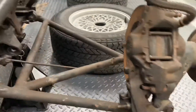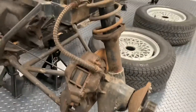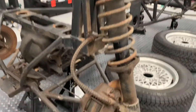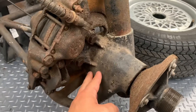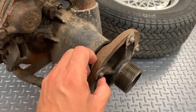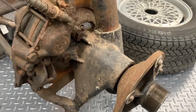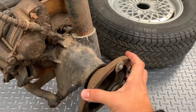At the back of the car, no rear anti-roll bar. It's actually quite a simple system with just the lower wishbone and the damper — not your typical McPherson strut-style setup. You have your hub here with the bearings for the rear axle contained within it. Drive flange again for going into the back of the wheel, with drive pegs to tie into the back of the wheel. In this case, it's got washers placed over the drive pegs to try and sort out the wonky wheel offset — but the less said about that, the better. Within your hub, you've got the bearings for the drive of the car.